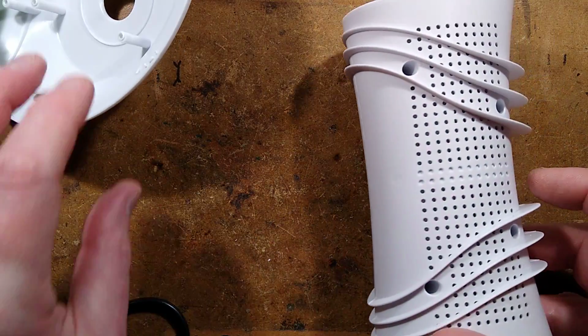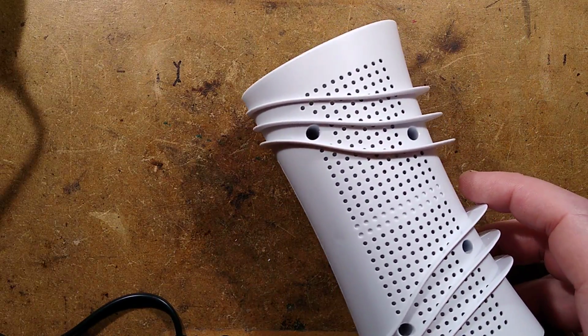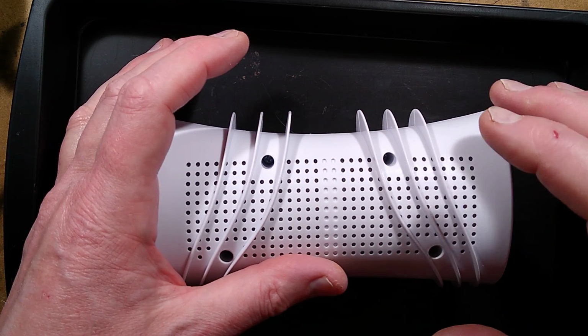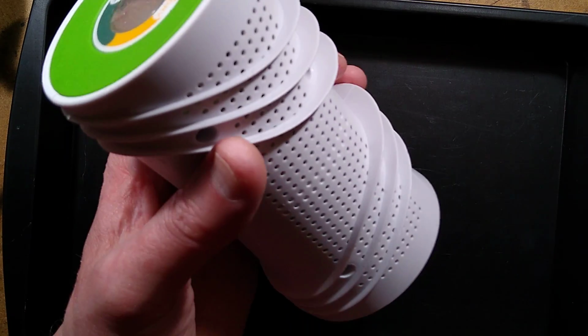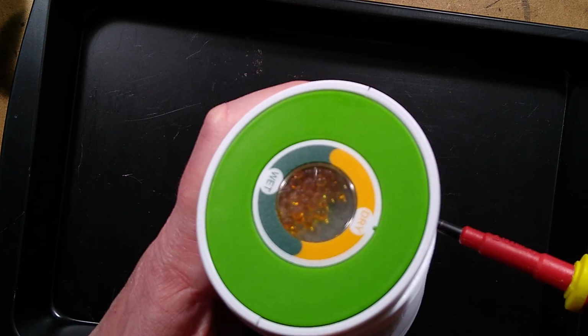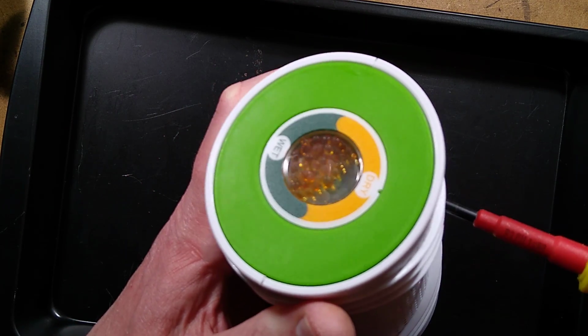That's odd. I've never seen the PTC thermistor in that configuration. That's very interesting. A very efficient way of getting heat out of a small area. But I restricted air in and it didn't seem to go down in power. It might have a quite high temperature rating. Or is it just fixed resistance? I didn't really see anything to regulate that any further.